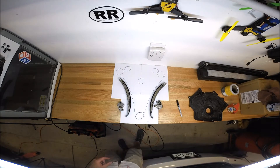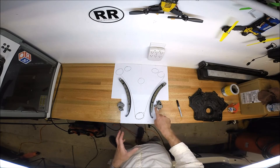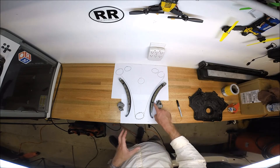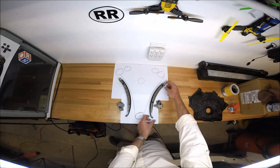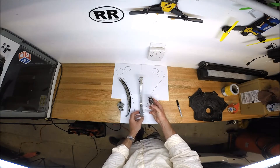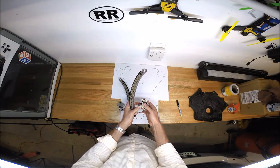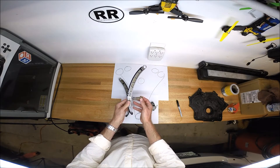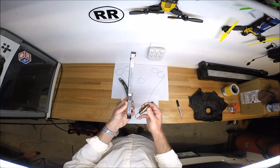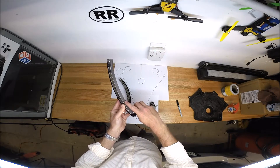This is a really interesting look into the failure inside the Ford 5-liter engine. We have a steel surface on the timing chain tensioner against an aluminum surface on the timing chain guides. What happens is, over time, this tensioner — in its job of pushing against this guide, constantly pushing — has actually worn itself into the timing chain guide surface.